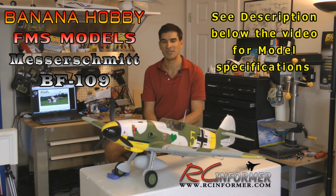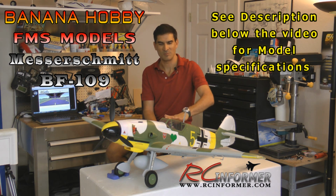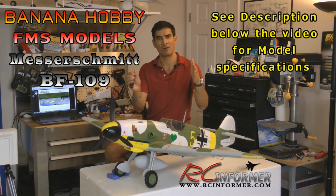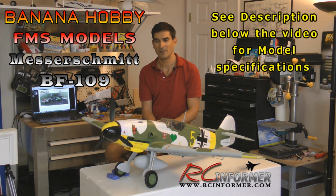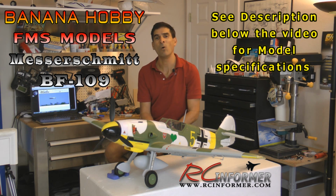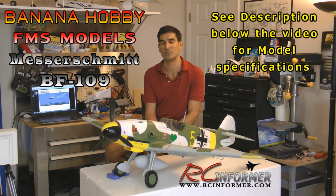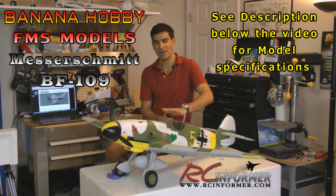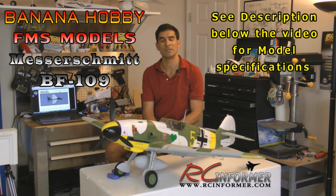You watch any YouTube videos of them taking off and landing, and particularly on grass, takeoffs, you have to be very careful, and that's because what you have is a narrow wheelbase. The wheels are close together. It has a very small rudder combined with a whole ton of power and a big prop up front. So taking off, you just want to ease the power forward, and as the tail comes up, you're going to be feeding some right rudder in when you take off.